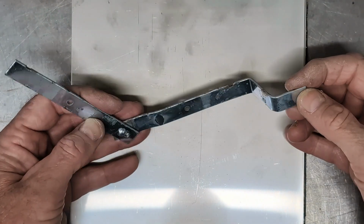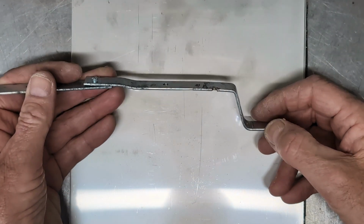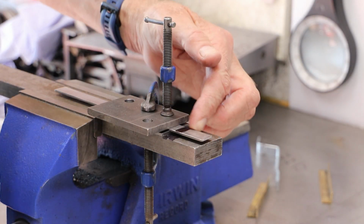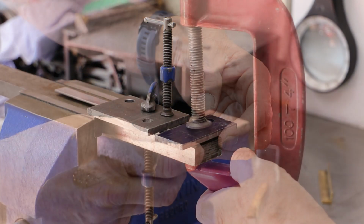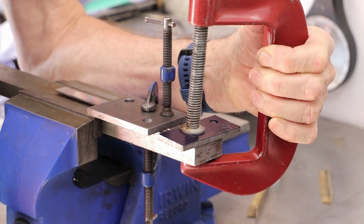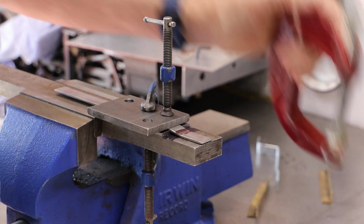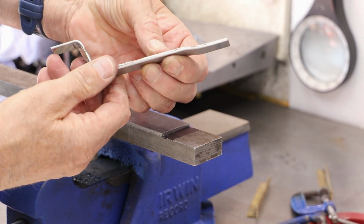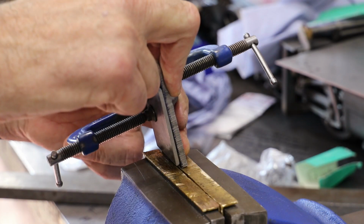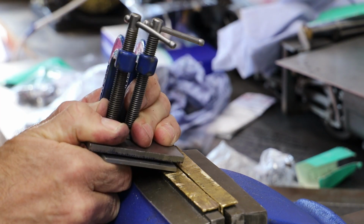The part that pokes out from under the seat has two offset sections, one for the overlap with the other part and the other for the handle. The first is easy enough to shape using some offcuts of steel and G-clamps. The handle is a bit more of a challenge, but again I managed to set the bends using pieces of scrap, G-clamps and my vise.